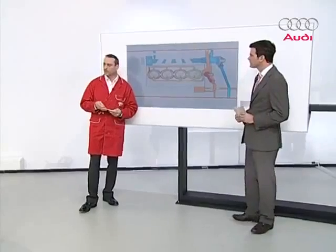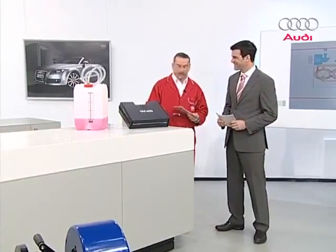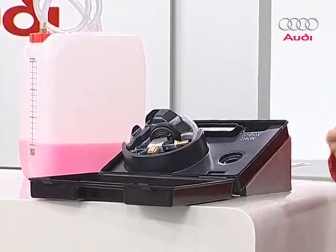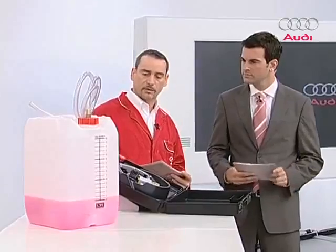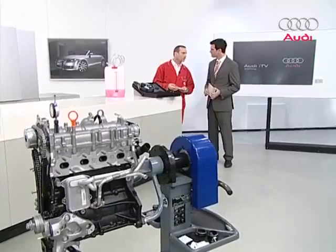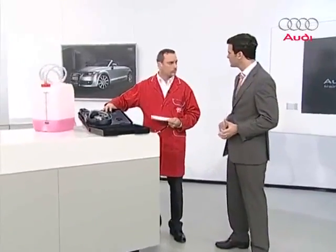We do have a remedy. The manual explains very clearly what to do when filling the cooling system. The instrument we use is the VAS 6096 — lots of service garages are already familiar with it. We strongly advise getting one, as it makes filling the cooling system significantly easier. This replacement reservoir must be filled accordingly, following the instructions on the sheet, which contains only illustrations so anyone can understand it. Everything is well explained in the repair manual.